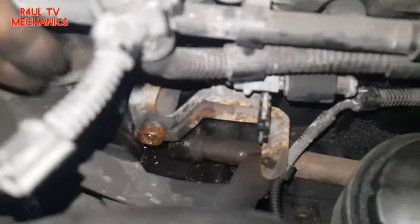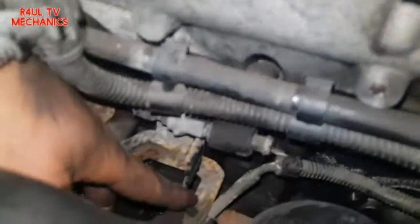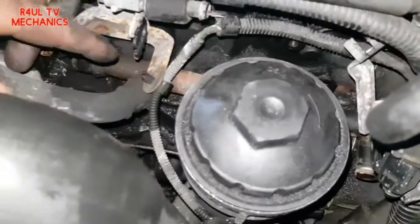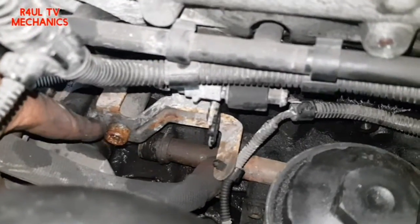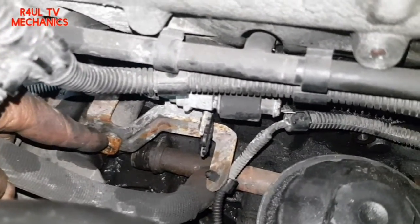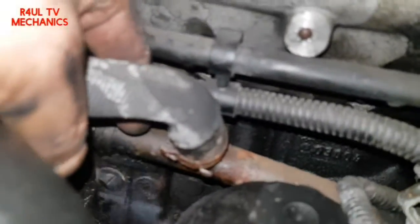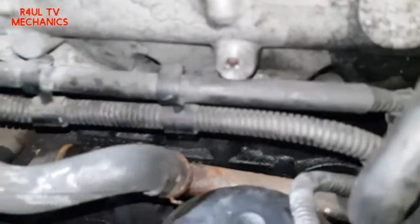It's separated from the bulkhead and the back of the water pump slash thermostat housing. It's just caught on this pipe. You can bend the bracket if you want, but I wouldn't recommend it — just take that little multi-spline Torx off, I'd say M8 or M10. Once that bracket moves out of the way, it'll easily come off. The pipe is off — plenty of space there. I can lift it up and gain access to the clip facing downwards.